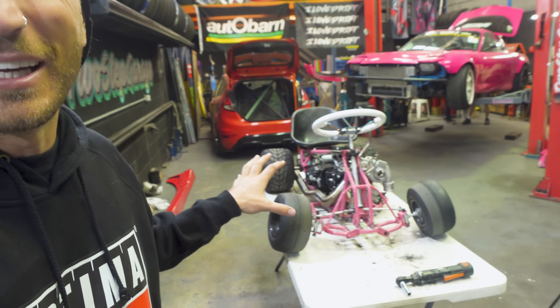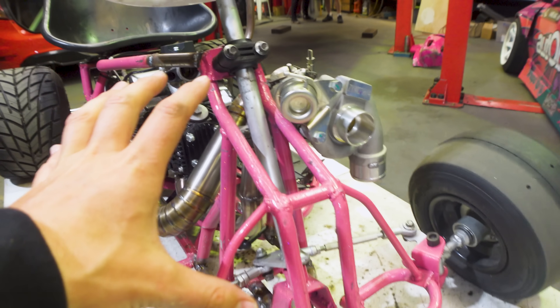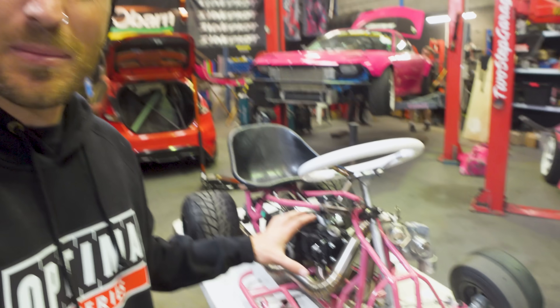We're absolutely going to make this thing pop flames at some point. So instead of having a cylinder where the boost can live on our setup, we're going to have something even better. We're going to install a front mount intercooler on our cart. This is one thing I haven't really seen many or any people do — have an intercooler on these setups. The intercooler and the piping will essentially work in the same way a plenum would, giving us the volume of boost to keep the setup efficient.